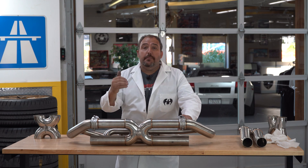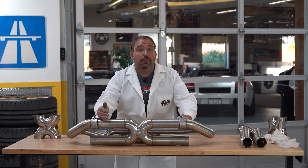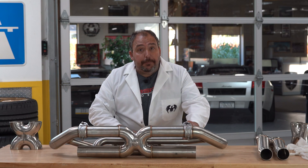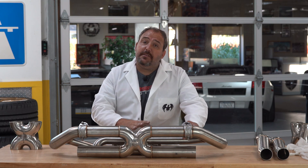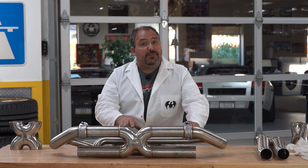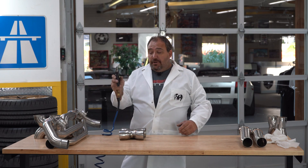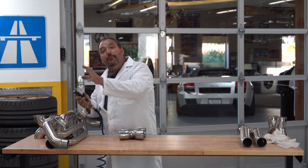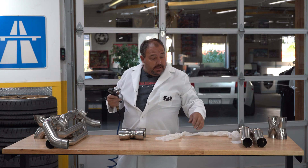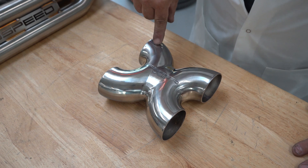It's noticeable every time you drive your car, as well as that fantastic ripping canvas sports car sound that FabSpeed systems are world famous for. I've got an X-Pipe here — I'm going to use some compressed air and some toilet tissue, and I'm going to show you how the X-Pipe works and demonstrate the principles behind it. This compressed air is going to represent the exhaust gases coming out of one bank of the engine.